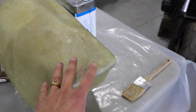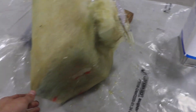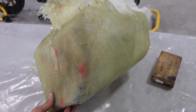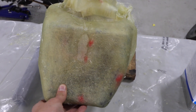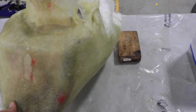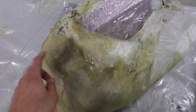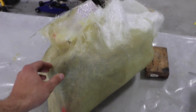For the record, I make no claim to know what I'm doing. This is my first time ever making anything with fiberglass myself. It's not perfect, but I wanted to just make my first prototype, see how it looks, see what I think of the shape. I'll probably still tweak it a little bit. I'm using fiberglass first because it's cheap and then hopefully do carbon fiber later. My method so far was just create a plug out of foam, wrap it in saran wrap so I have the shape, and then do some fiberglass. I'll cut all the excess off, put it on the bike, see how I like it, and then go from there.